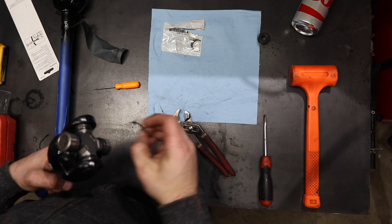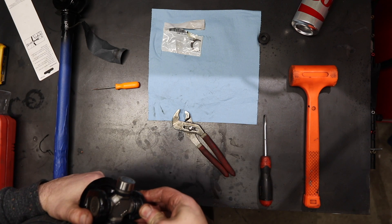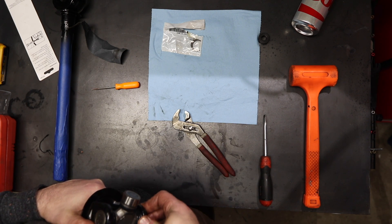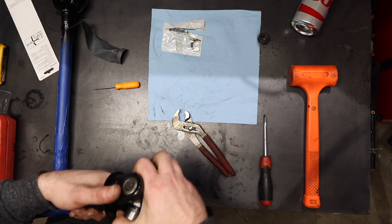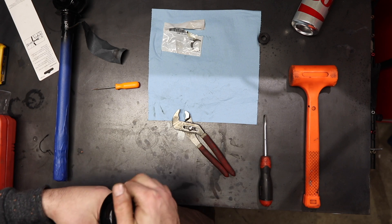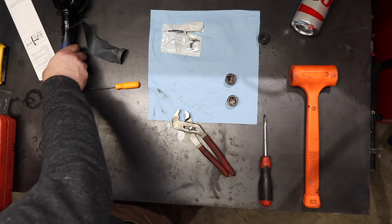Did I mention I love my 20-ton press? This side's retaining ring will go in harder because it's usually — oh no, that went in pretty good. So that's in there — that's one side done. There's going to be plenty of drag and that's okay — it's not supposed to be loose now.